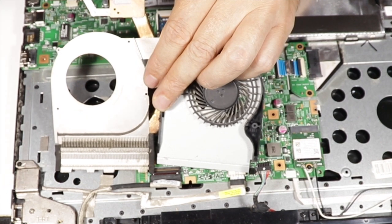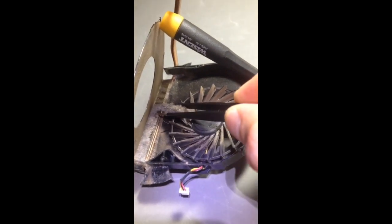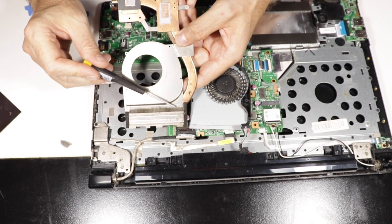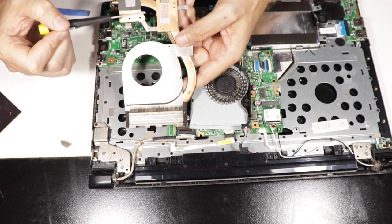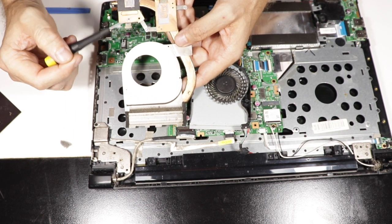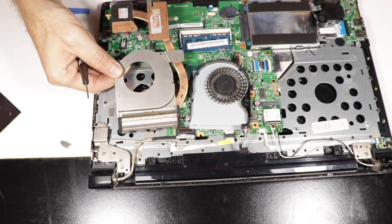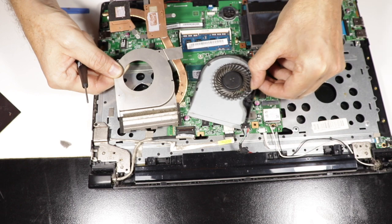Not much in this laptop, but some laptops have their radiator completely clogged with a carpet — like a lint carpet — so there's no airflow anymore. As you understand now, if this part of the radiator is all clogged, this copper pipe which goes over the CPUs and GPUs cannot cool them down. And that's why we have failures of GPUs or CPUs. This is basically, in my experience, the most common issue that causes GPU and CPU failures.